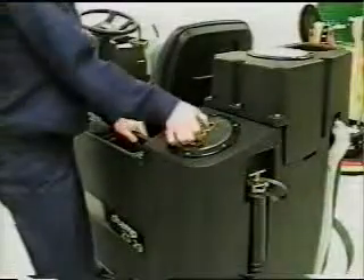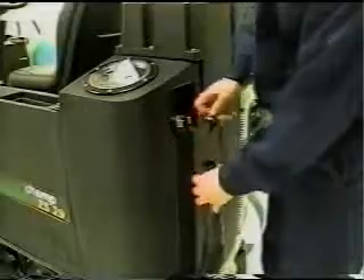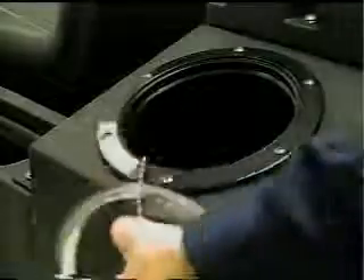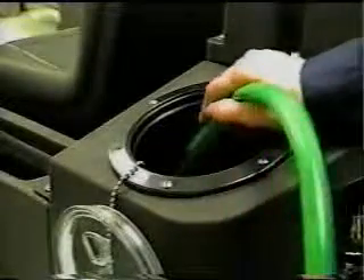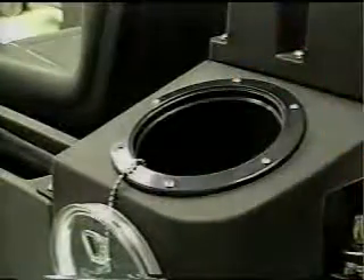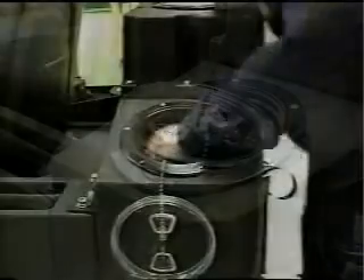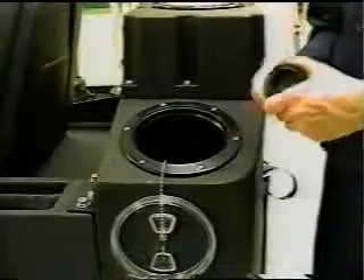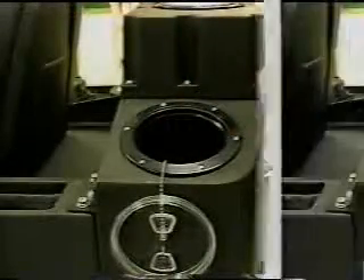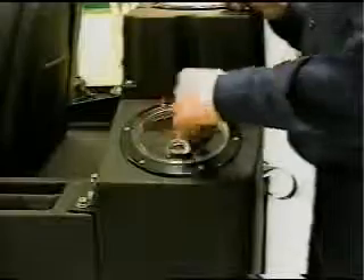This is the recovery tank. The plug in the recovery tank drain hose is easy to remove and replace. Be sure to drain the recovery tank when it's full and when you are finished using the machine. The clean-out port is here. After every machine use, spray clean water into the clean-out port to help keep the recovery tank clean. Leaving the clean-out port cover off between uses will allow the tank to dry and reduce odors. Be sure to remove and wipe clean the float after each machine use to prevent it from failing. Always remember to replace the float and screw down the clean-out cover when you next use the machine.